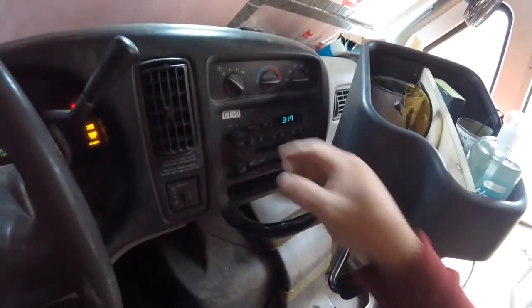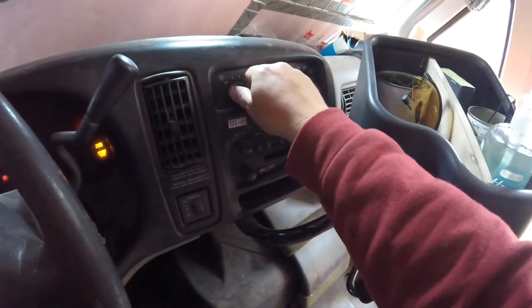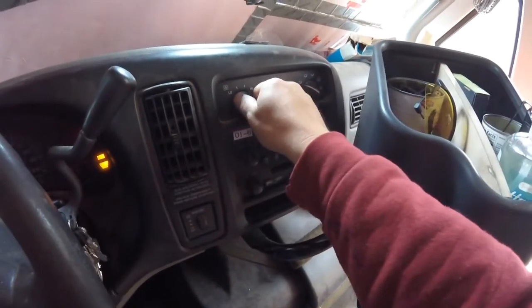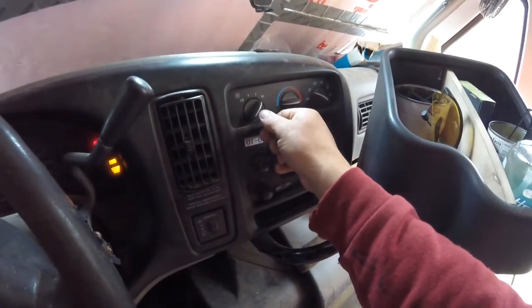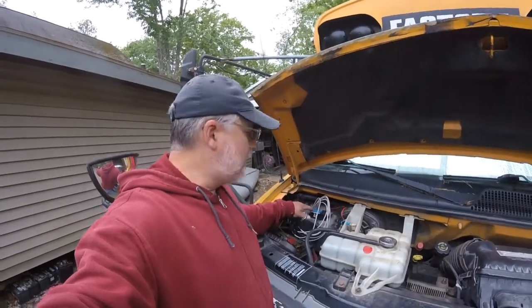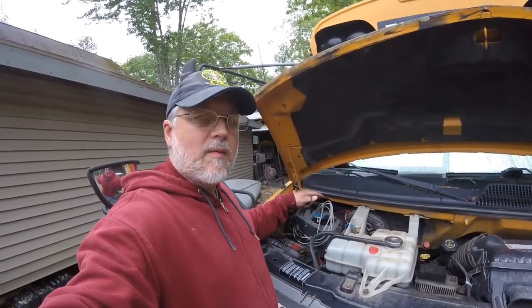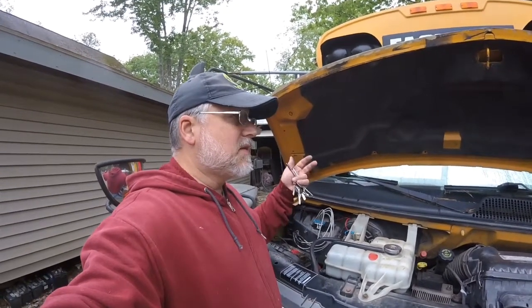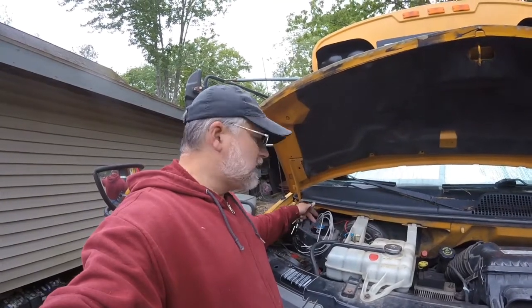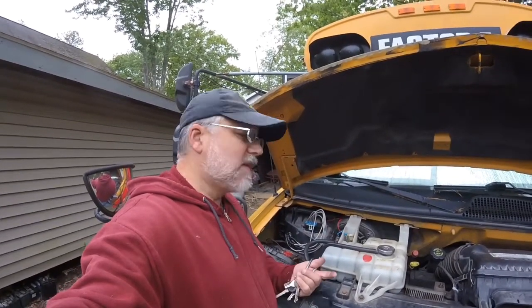I'm going to wait for that sound to go away so I can hear the fan. I can hear it on low. The next setting's working, and the next one, and high — all four settings seem to be working. So that wraps up my fan problem for inside of the bus. It was only working on the low setting. If I have any problems in the future — anything burning out — that's going to indicate an underlying problem somewhere else. I'm hoping it was just that this is a 2001 with original pieces that over time something happened. Hopefully this will not happen again, but if it does, then I know I have another issue.